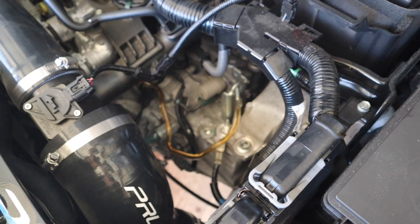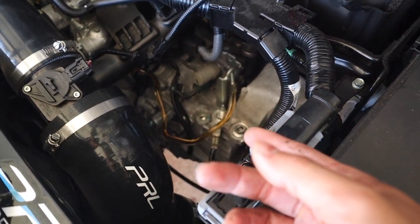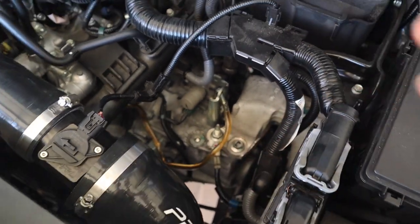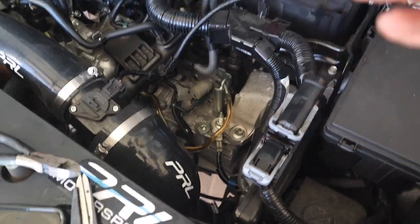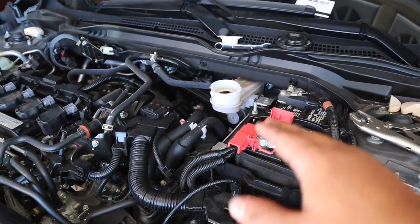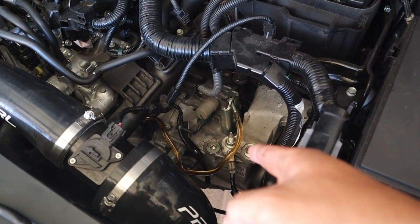When you take out your slave cylinder, you're going to want to make sure you have something connected like a hose line or fuel line — something that just holds the fluid so it doesn't leak. I'm just going to make sure we don't lose that much fluid. You want to keep an eye on that — you don't want it to go below minimum, otherwise you have to bleed more.